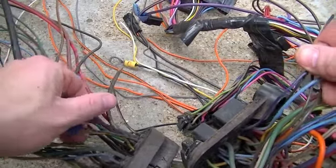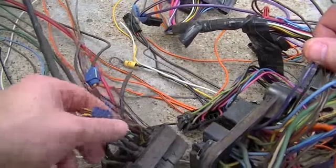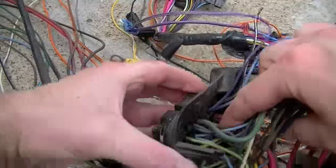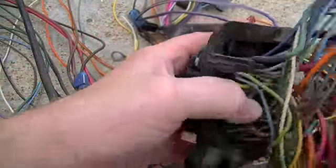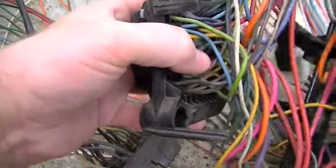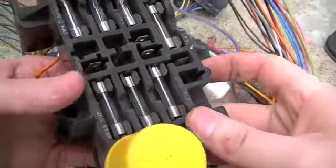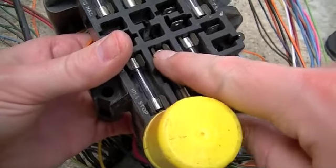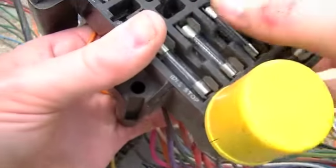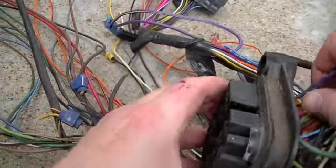Then we got dark blue and dark blue. And this yellow and black wire — that's our 12-volt source. I can trace that out here on the inside of the wiring harness, which starts right down in there. I can trace that wire over here to the actual fuse panel, and it connects right there. The writing on my fuse panel is faded so I can't read it, but it doesn't really matter because now I know which wires go to which.